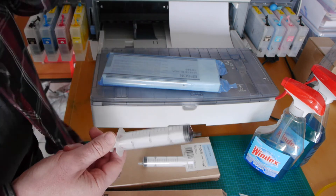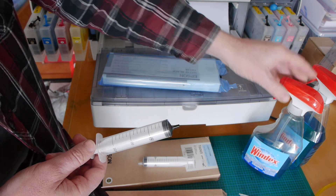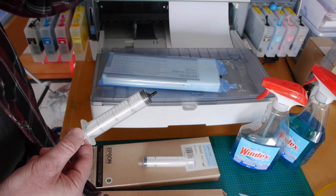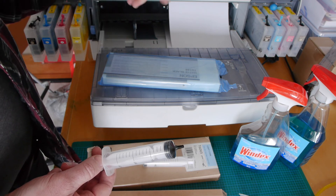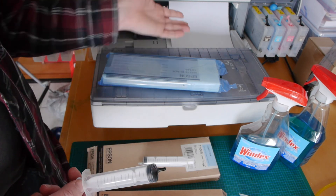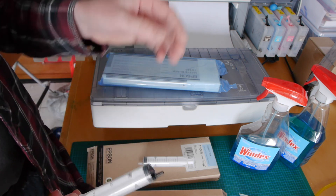So there you go — that's refilling. Keeping it clean would be another video, like keeping the nozzles clear and all that, but it's not that bad. You see I have some Windex here — it does happen. I don't use it very frequently, but if you don't use it for a few weeks or a month, you're spending a good hour cleaning it before you can print a decent print. So best thing is to keep it running. I used to print stuff every day, but I find it easier just to clean it once a month and keep going, instead of having this thing print out every day. I know you're supposed to keep it running, but honestly, it's just easier to clean it and then print when you need it. Thanks for watching, and I hope that helps you.